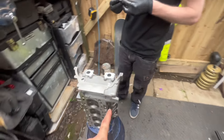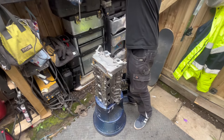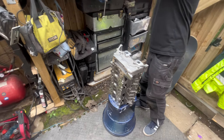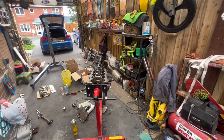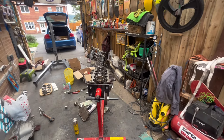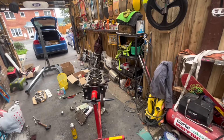I'm going to leave James to do that now — it's quite a timely process. Fingers crossed we'll have the head done in no time. Then obviously we'll get back on to get the rods and pistons. We've got to put the rings on the pistons and measure them. This is just a snapshot to put that engine together and you can see what we bought and everything that has gone into it.